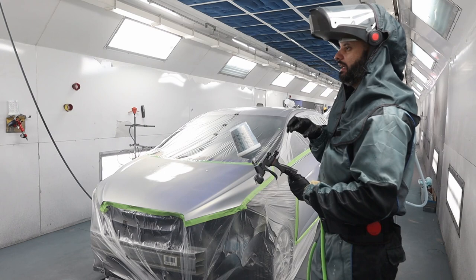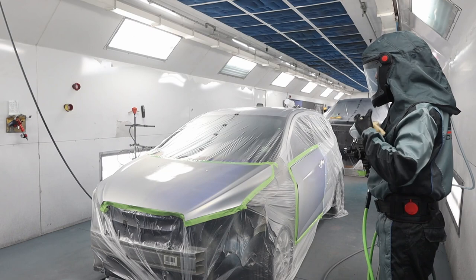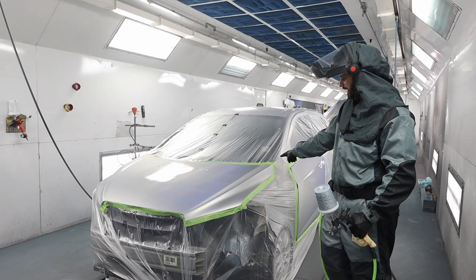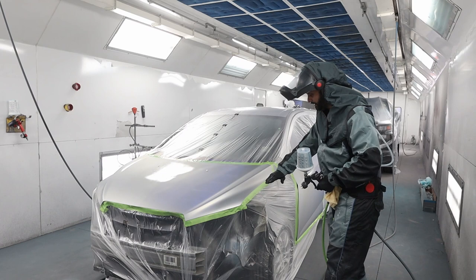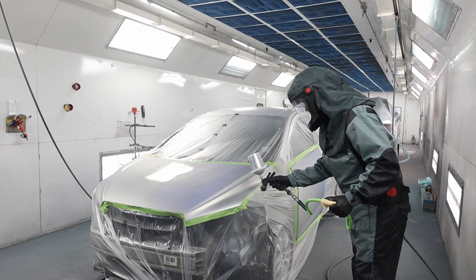Today I'll use the clear coat gun too, spraying at about 23 and a half PSI, fluid wound in about two and a half turns — this gun is pretty fast. Fan fully open. Being that this is Ultra 9K you can go wet on wet with your coverage coats, but when I'm blending I like to actually see what I'm doing. When I have a body line like this I'm going to utilize that to keep my blend extremely short.